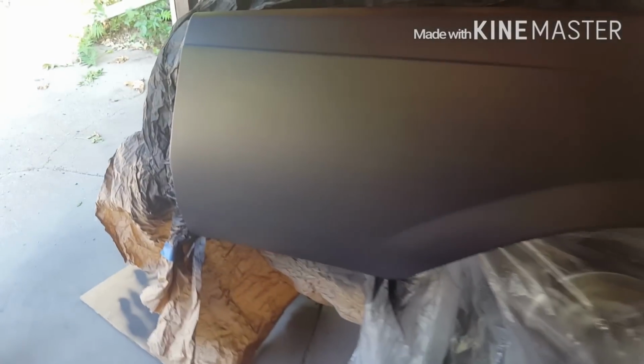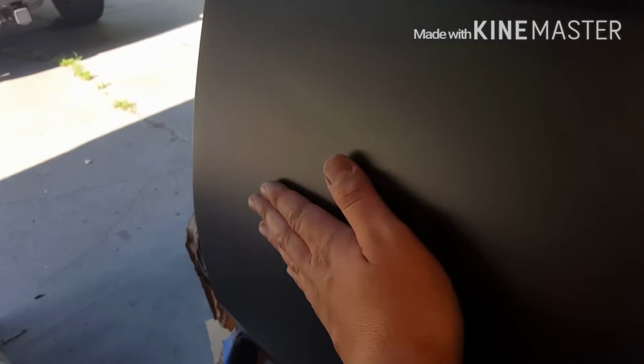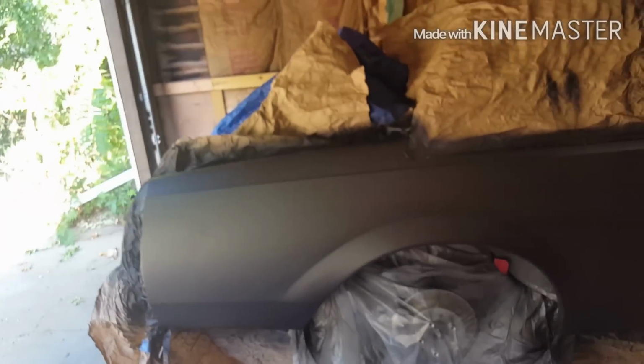So still gotta go through and jam it. They're pretty good though. Not good enough for me, you know? I'm not going for perfection here. So, looks pretty decent. That's the other thing I don't like about it. I don't know if you can see. Yeah, there you can see it. It's kind of coming through on my screen. You can kind of still see, I mean, there's no lip here, it's nice and feathered in, but you can still see the Bondo through it. That just shows you how thin this stuff is. I'm not very happy with that.